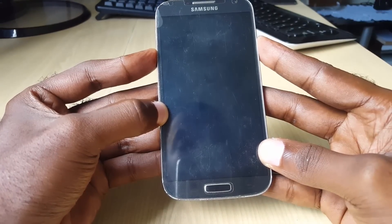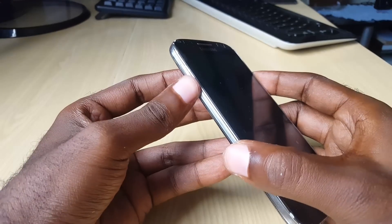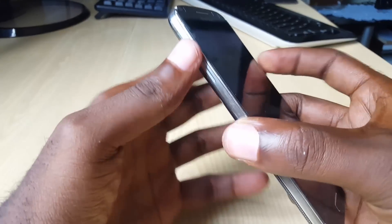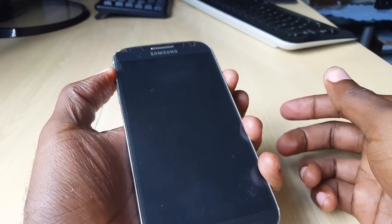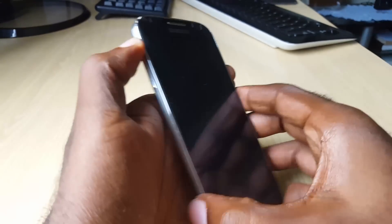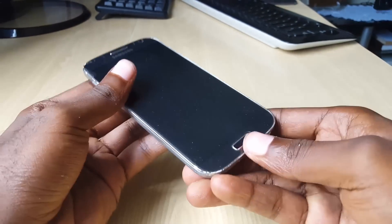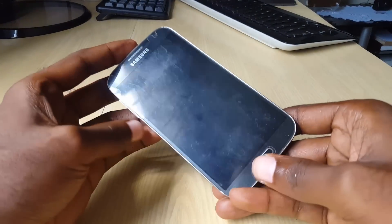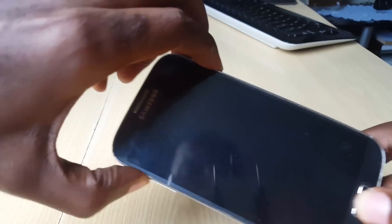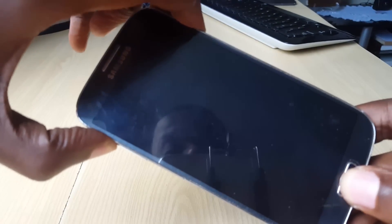For some of you, just doing that will get the device to power up. If that didn't work, go ahead and hold power and volume up, and try that. We're trying these variations because every device is different. If that doesn't cause your device to boot up, next we're going to try to boot into what we call recovery mode. For most devices you're going to press the home button, volume up, and power.